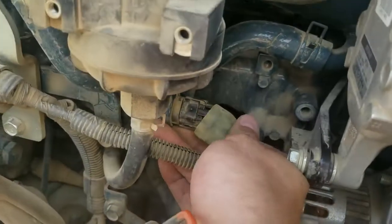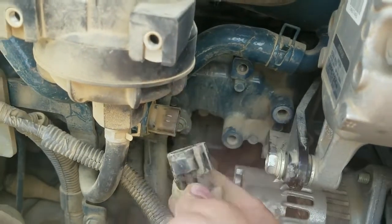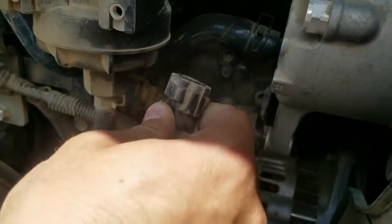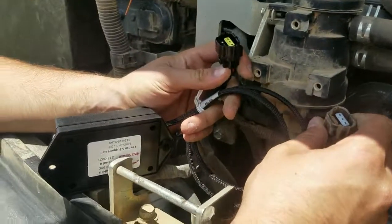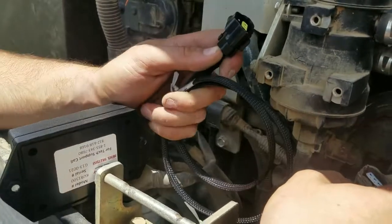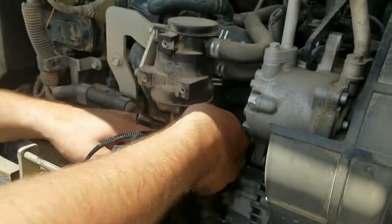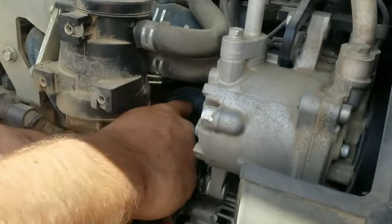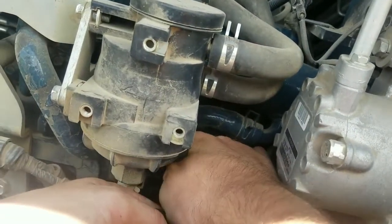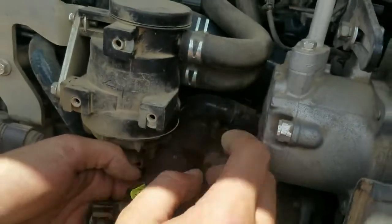Here's the fuel rail sensor. We're going to go ahead and pull back this rubber protective sleeve and release this 3-pin female connector from the rail with just one quick click. Then you'll go ahead and — as you can see, we use factory OEM grade connectors on all of our harnesses and modules — place our female connector on the end of the rail from where we removed the factory one. Be sure that that clicks in, which ensures it's locked properly and will not come off.